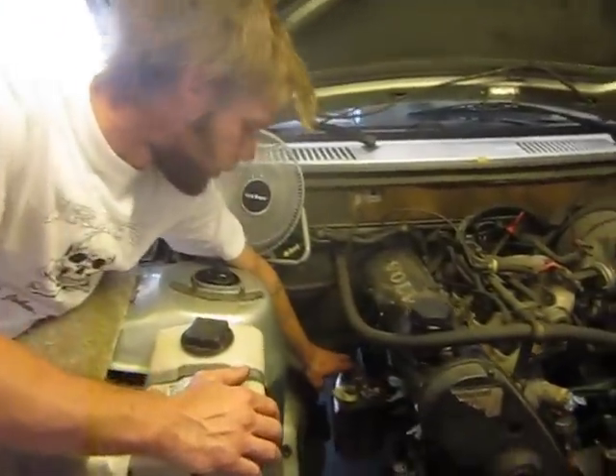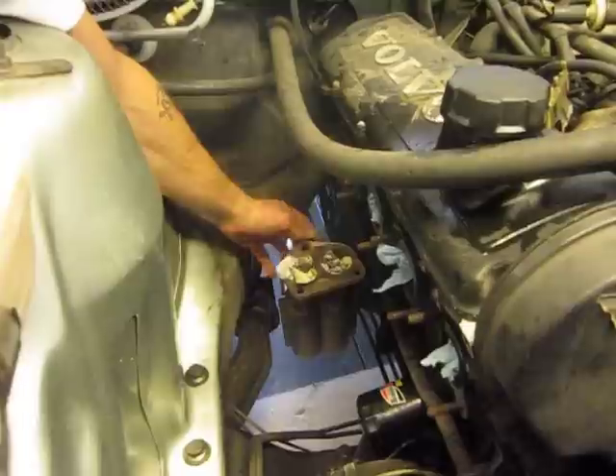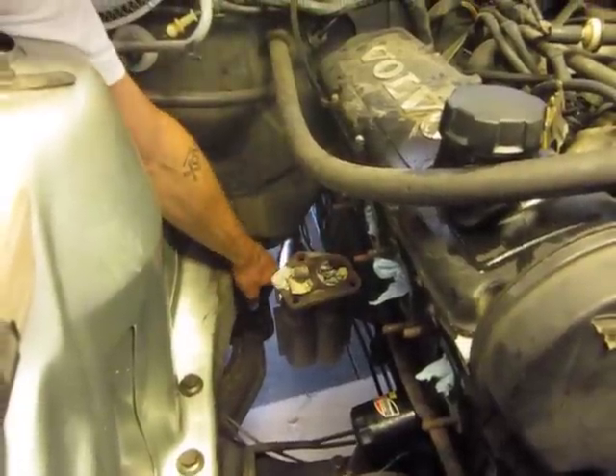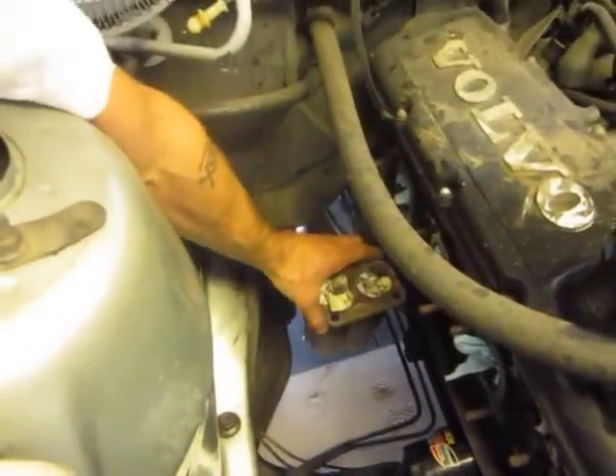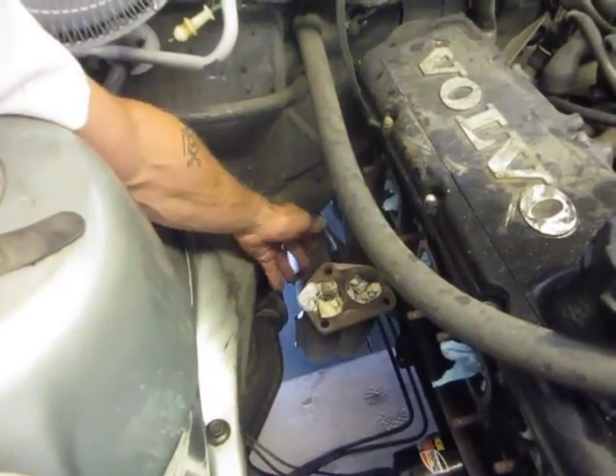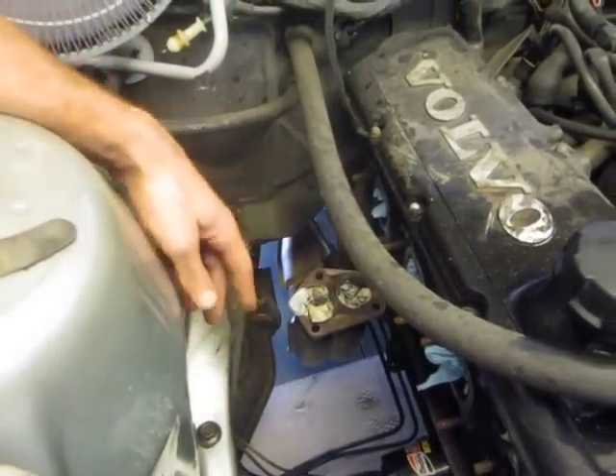What I would do is — there were three bolts on this manifold. So now that you have this open, the manifold off, there are two bolts down at the bottom of the manifold on a hanger. You want to go ahead and loosen those up while you have easy access, because you're going to have to loosen that up a bit later.